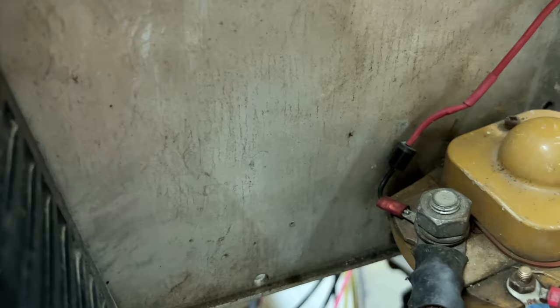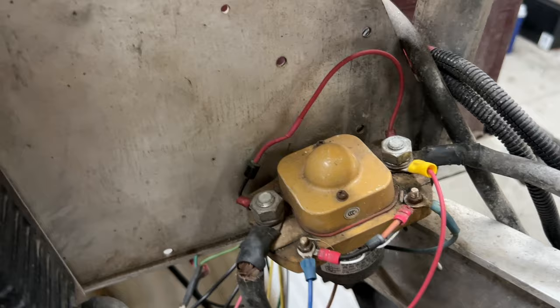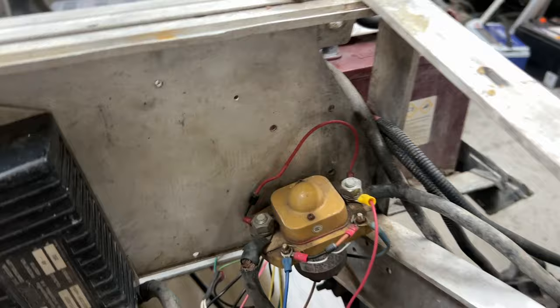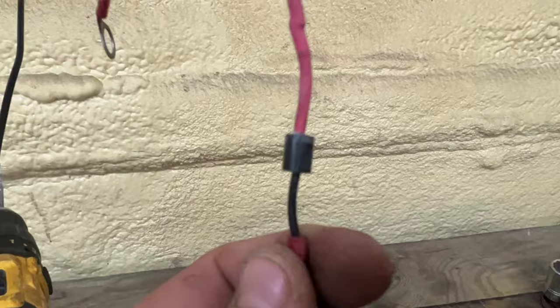I wonder if somebody didn't put a diode there that needed to be a resistor. And if that's the case, well, the power is not going to jump through a diode because that's there. The resistor is there just to kind of soft load the controller.